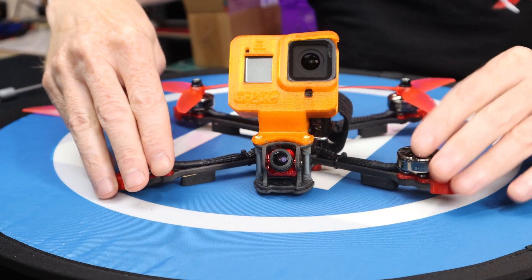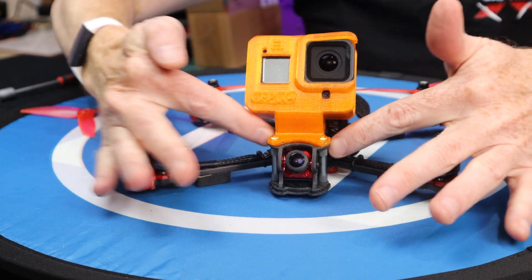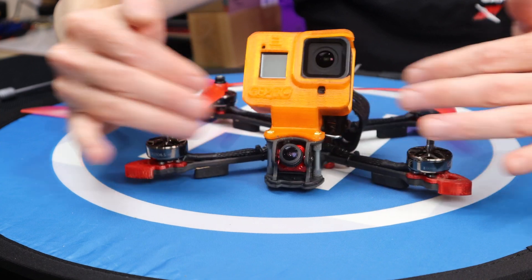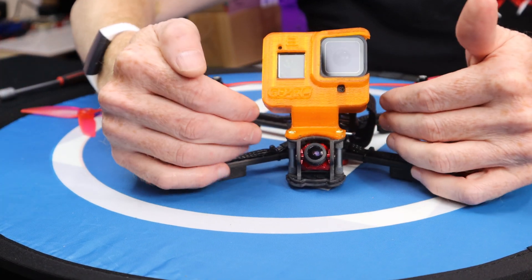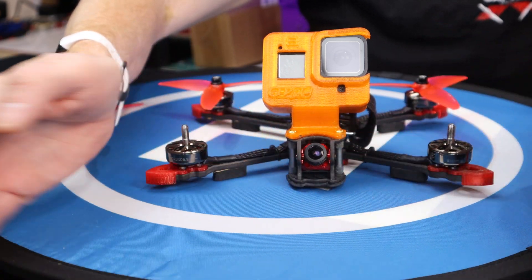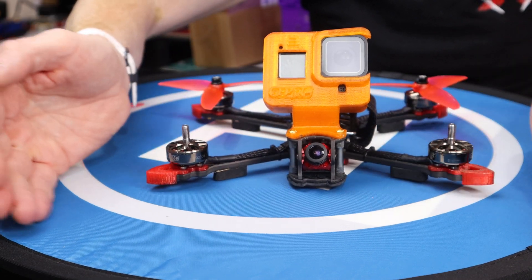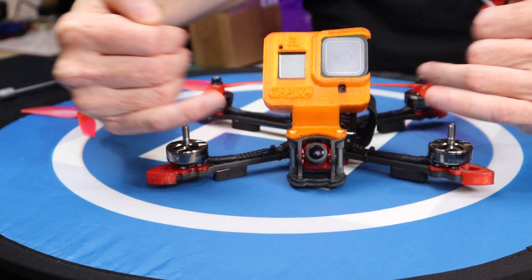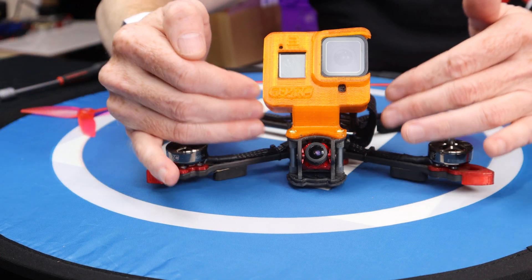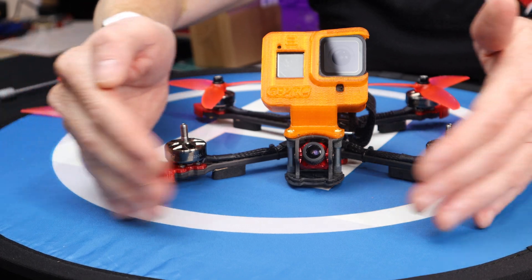Take a look at my drone right here. Props in means I put a prop that's going to blow the wind toward the center — toward my head, so to speak. Props out means the wind goes away from the center. Props in is on about 80% of quadcopters. If you're ever in doubt and you don't know what to do and you have to put props on, put them props in. So how does that relate to the actual prop? Let me show you.